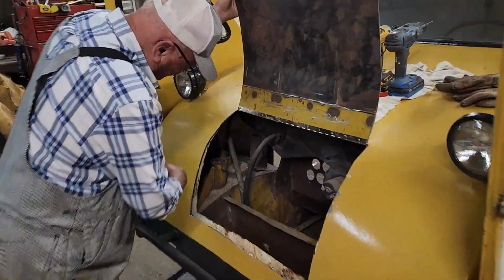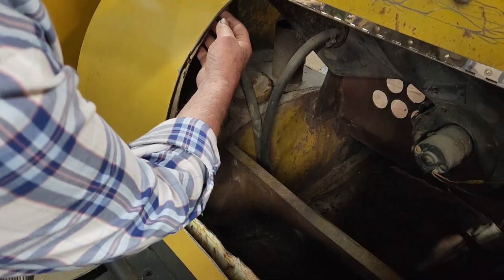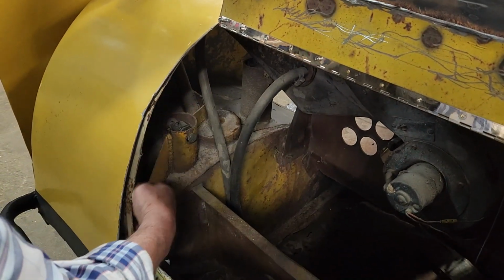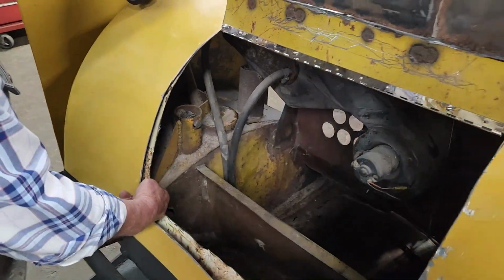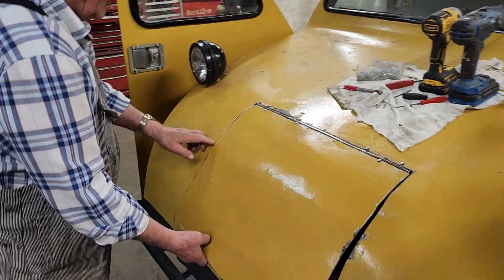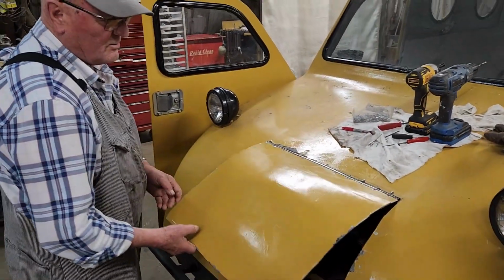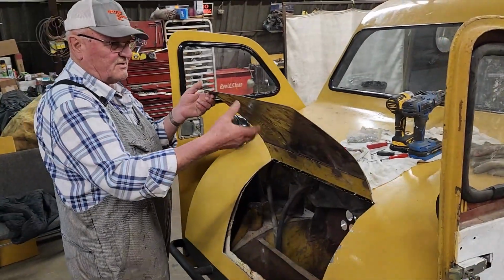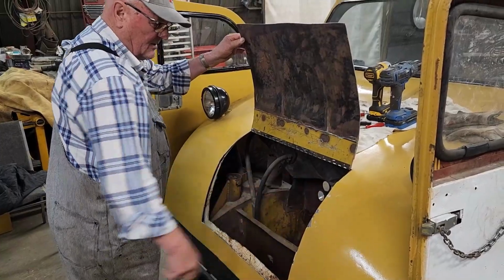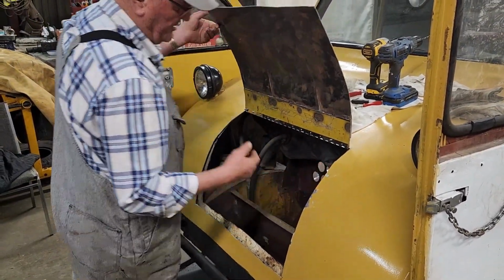They put a sheet iron right over top of the old one and then welded it here. So I gotta cut this off. Okay. Because I have to put a chunk in behind here for this door to sit on, eh? Okay. So it's flush. Yeah. So I gotta bend this, get more of a curl in it, and cut this off so I can get a backup bar in behind here.